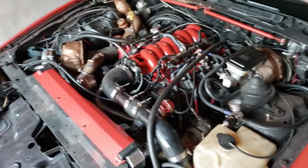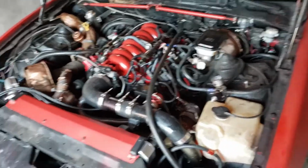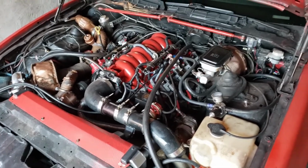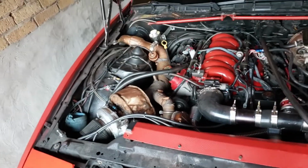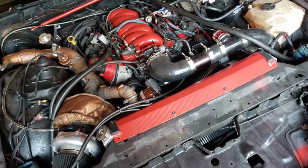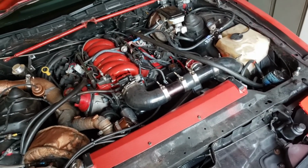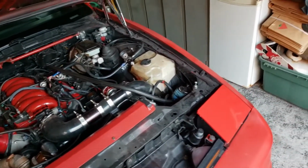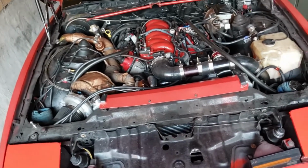To keep this thing happy at the point where it's tuned to be at like the 180, 190, and make tons of power safely at that point. Once it gets heat soaked, it's a dog. Getting the intake temps down and the methanol on helps a lot, yeah, sure, to make power, but the heat alone, just the coolant temps are sky high, which means the oil is also ripping hot as well. So it's just baking and stuff that I just don't want it to make the power that I want to put the boost back up to.